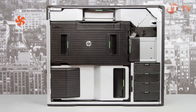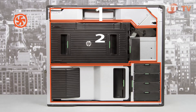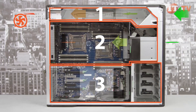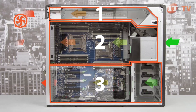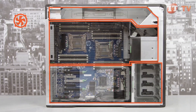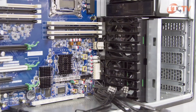The chassis is based off the Z820 model and features three separate and distinct cooling zones for the components: one for the PSU, another for the CPU and memory, and a third for storage and I/O. Shrouds over each of the cooling zones give the system a very organized and well-thought-out appearance. Fans for each cooling zone have separate sensors on the system board to ensure the fans only run as long and as fast as required to keep the system at peak operating temperatures. Internal cables are also very well organized and unobtrusive for better component access and airflow management.